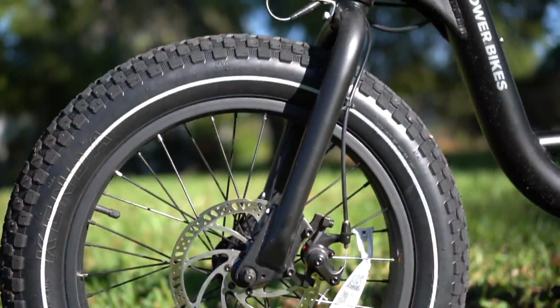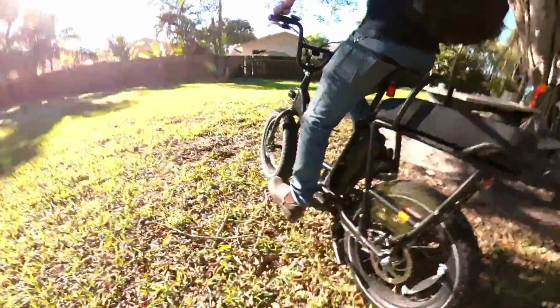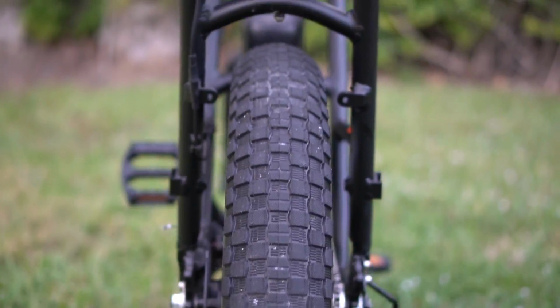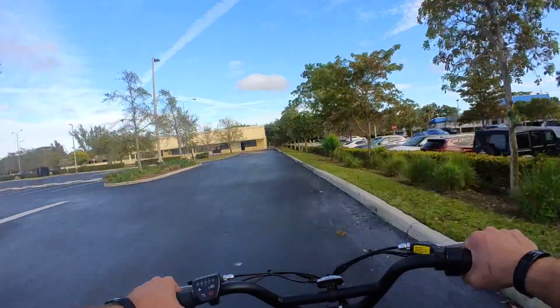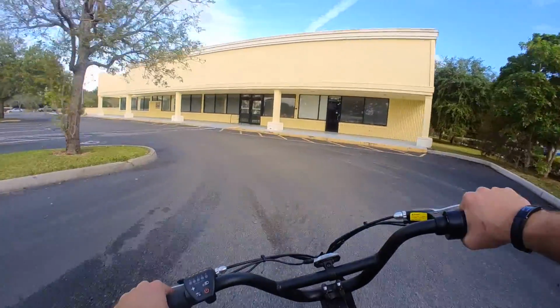Plus, it's got those 3.3-inch tires that make it comfortable to ride off-road and on trails or even bumpy grass, even without the bike having any suspension at all. 3-inch tires feel like this nice balance between narrower city tires and full-on fat tires. They get the nimble benefits of smaller tires and the cushy ride benefits of wider tires. And I love that 20-inch size, since it keeps the bike rather small without reducing the ride quality too much.